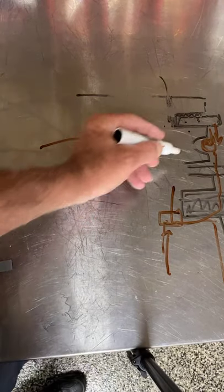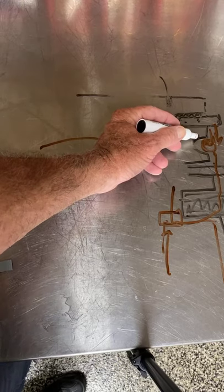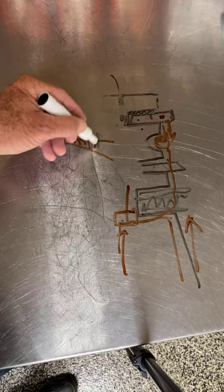so that when this ring goes to that RPM where the horsepower noses over, if you have 20 inches of depression, 20 inches of crankcase vacuum under this top ring, this fall off after peak horsepower will be less. So you have a lot more power after peak.